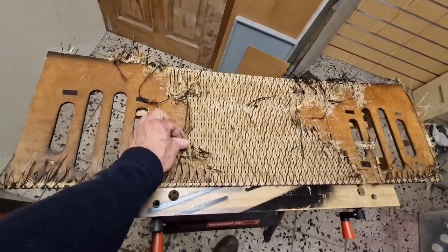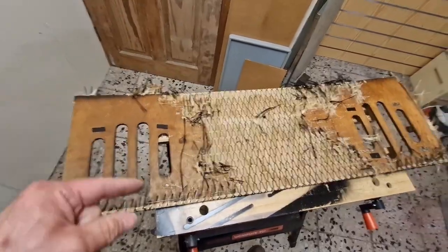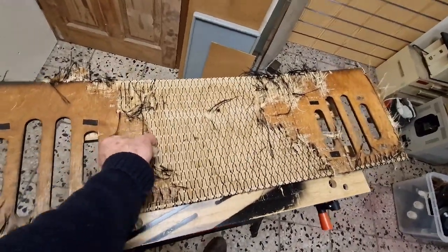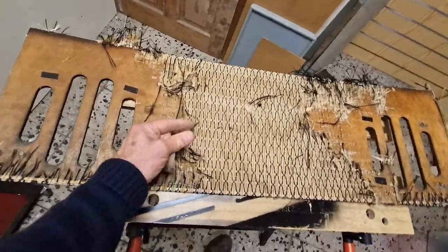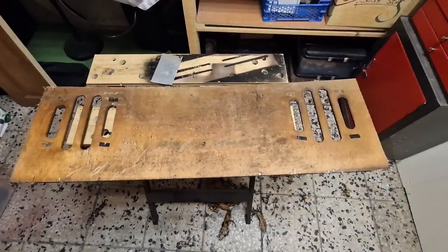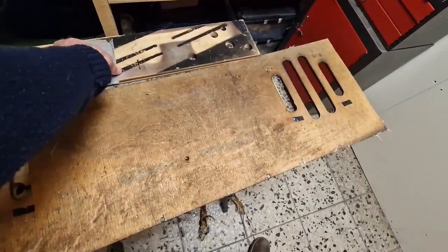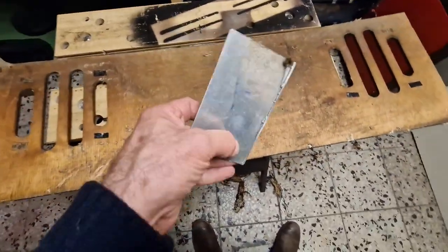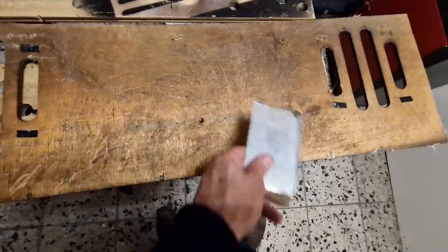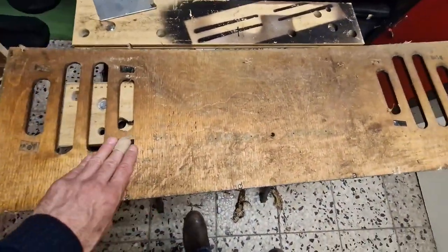It's really stuck on here, so I was going to do a little time lapse instead of showing you taking it off, but it's going to take quite a while. So I'm going to pause the video, get this last remaining piece of cloth off — which is stuck on like you wouldn't believe — and come back when it's all clear. Finally got all the original speaker cloth off. I used the hot air gun just to warm the old glue up, and then just a rough old piece of off-cut aluminium to scrape it all off. So it's nice and clean.